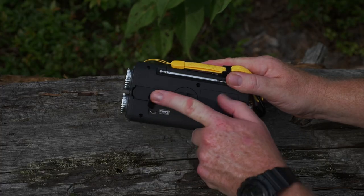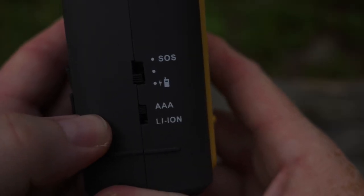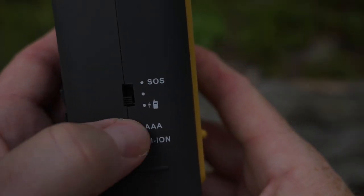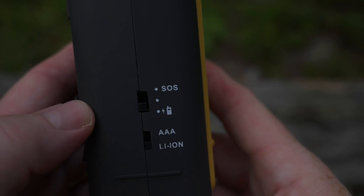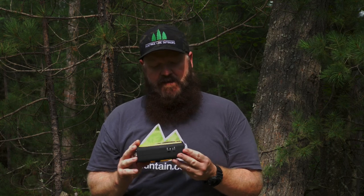In the back there's a micro USB input and a regular USB output — that's what you use when using it as a power bank to charge things up. It's got two switches: one for if you're using the AAA batteries, and just below it the lithium switch. You'll want to keep it on the lithium setting for any time you're using or charging via the lithium battery. If you're charging it — whether through micro USB, solar, or hand crank — you want to make sure the radio is off. That's one of the things that allows the lithium battery to charge.